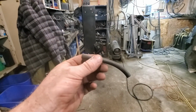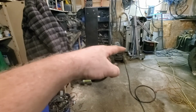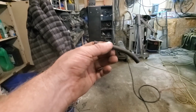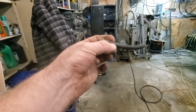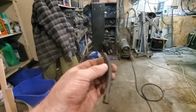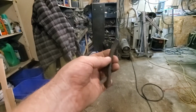The fuel hose itself is eventually going to have to be done too. But now it's copper line from the back pump. It goes around the fan. So if I hear ching, ching, ching, ching, ching one of these days, it's the fan hitting the new fuel line. They don't have this going beside it because it's too thick, and the copper line's actually a little bit better. So I have it running beside. There's enough room there for it, and then cinched it down. And then I ran like that much from the copper to the new fitting, and then good to go.